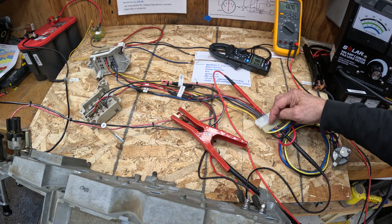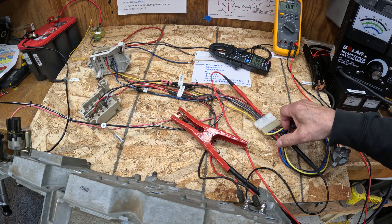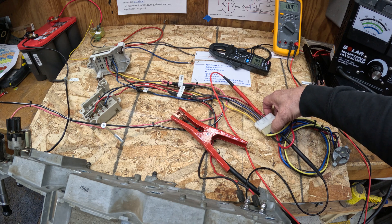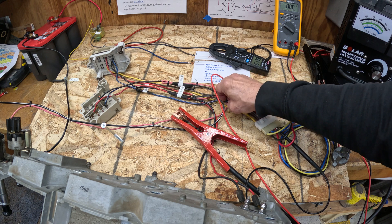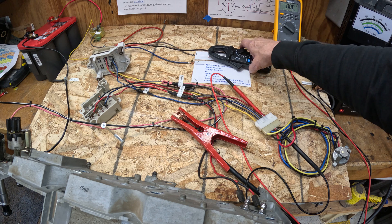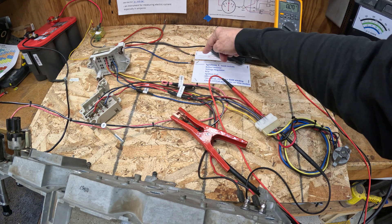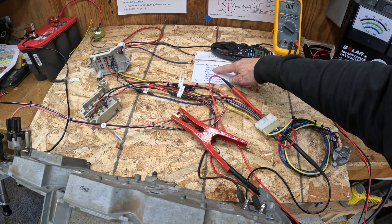It's usually the red wire that shows the most heat damage, because all the switched currents go through that one power feed. In the other direction, yellow is the starter relay — there shouldn't be a lot of current there. Ignition 1 is here, and if the ignition system is powered up you'll get some current through the blue wire. Most of these cars run that straight out to the bulkhead and then to the engine harness, where it's typically a 16-gauge wire that splices into smaller wires going out to the individual devices.